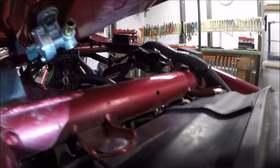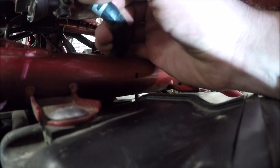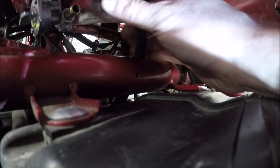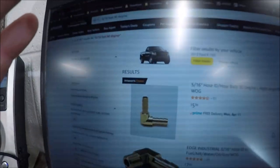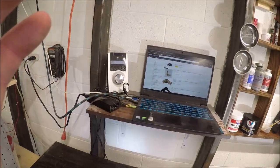I'll be honest, I don't actually like the amount of stress that that bend is going to take now. I can get the fuel line on there and the clip over it, but with that 90-degree bend I don't like the stress that's going to be on that fuel line. I'm not actually going to be able to finish this today, but I think I'm going to put a 90-degree 5/16ths barb on there — that way I can take off a lot of that stress.